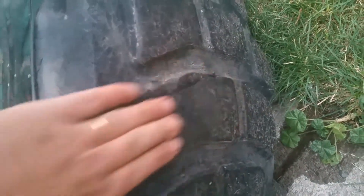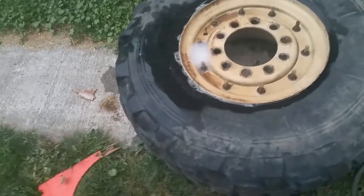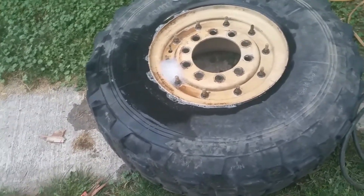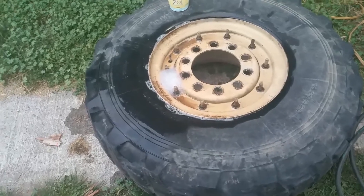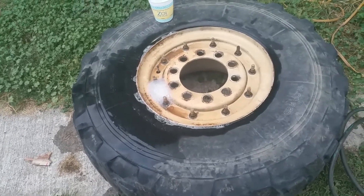One thing I did notice pulling this tire — look at that — you can almost see that these two tread blocks have blended together. It's lost that gap. See it coming back? It's right there in one spot. That is balancing. I had kind of abandoned the idea of fluid balancing these things — I just didn't think it worked well enough to deal with the mess. But it might be time to go back and re-look at balancing these.